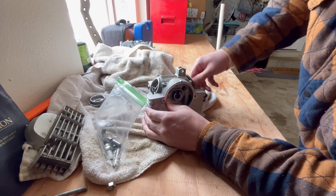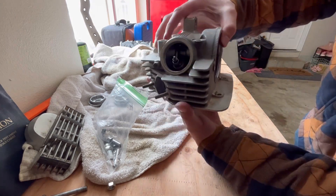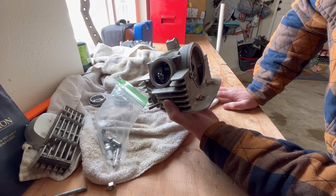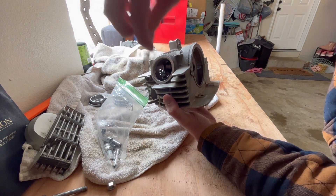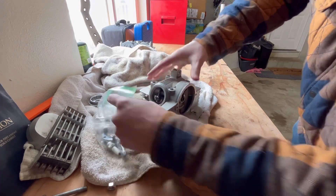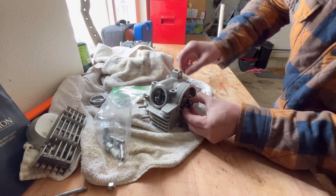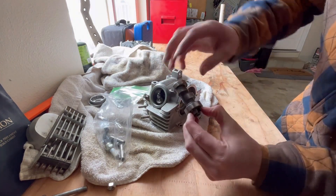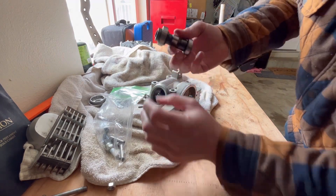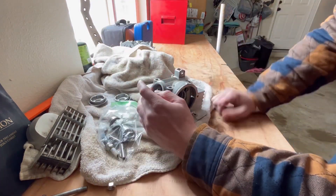One thing that I really like about these simple motors — TTR, not the race ones — is to adjust your valve clearance for timing, that gap is just right here. You don't have to have shims like you do on the race bikes. Anyway, once that's out, these are loose and then you can pull your cam out, and that comes out one piece. I've already inspected this and it looks pretty good, so I don't think I'll be replacing it.